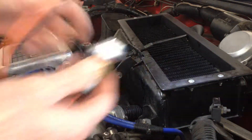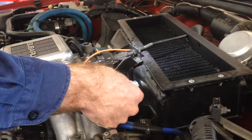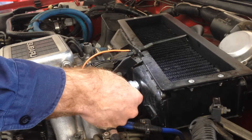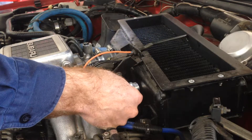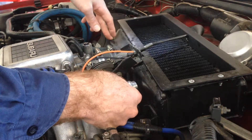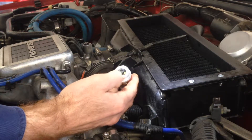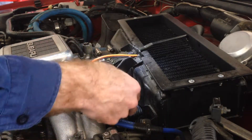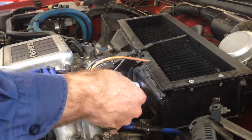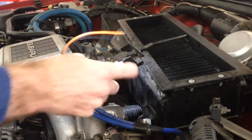I think I'm going to put the sensor just here — it's really the only place I can put it. I'd like to put it closer to the throttle body to get it into live air, but there's really no room. I've got the TPS here in the way. I was going to put it underneath but I don't have enough room, and I thought there might be a problem with the sensor filling up with oil. So I'm going to put it here — that's as close to the throttle body as I can get. So it's off with the intercooler to weld the boss on.